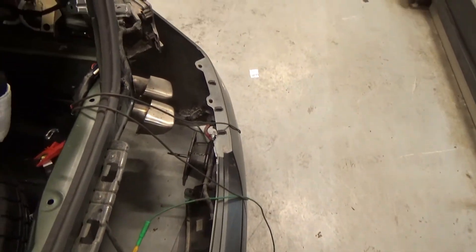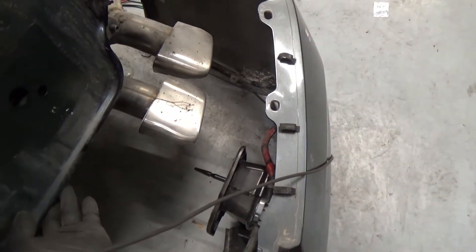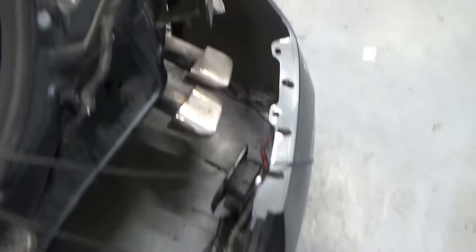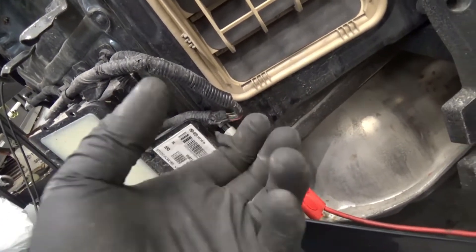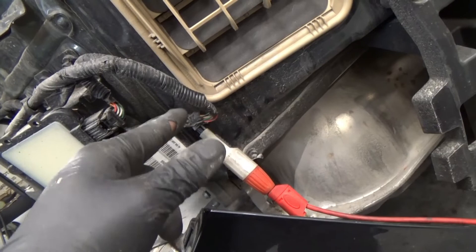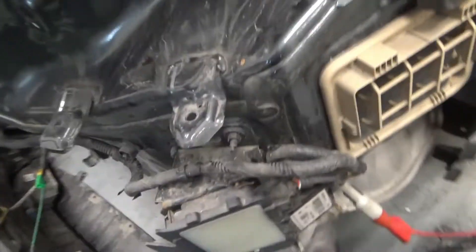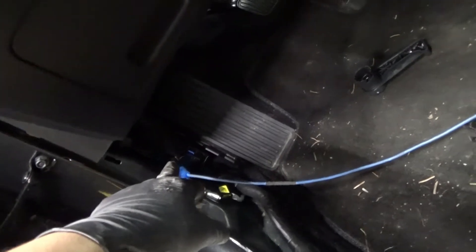I removed the bumper — pretty straightforward on this one, unlike the Hyundai where the bolt is at the bottom; here it's inside this panel. There's one lead here and another lead here. I'm suspecting this area because that's where the harness gets squeezed. There's a big harness going into the car, so I placed our scope leads there, plus one lead on MF11 going to the IBU.